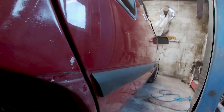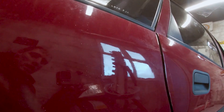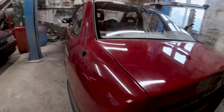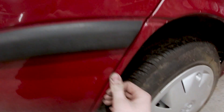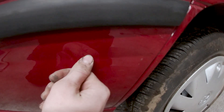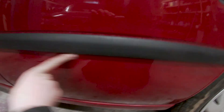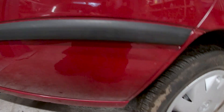We're going to do this in one way - we're going to paint the bottom of the doors and forget about the top, we're not worried about the top. We'll blow in right round this and blow that whole quarter panel in right to the top edge. We don't even need to touch the top of this quarter because it's actually alright. There's just wee damage here and a line there as you can see in the video. We're just going to fix these, blow a bit of primer on them, and prime them.